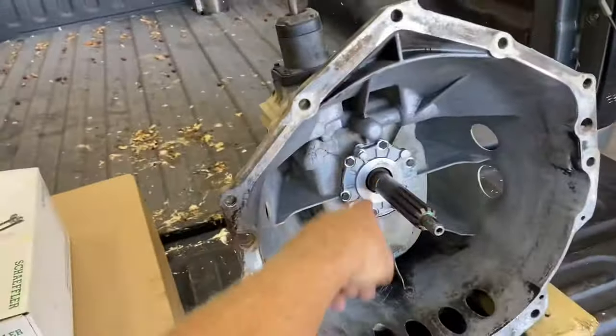I think we're gonna put that to the test, I promise. But I'm thinking that's gonna be about peak for them, 500-600. I'm thinking more of the 500 horsepower range. But anyway, this is their aftermarket clutch. There's the part number there, and I went with an OEM Summit flywheel for the 4.8, of course. But there's your part number there if you guys want to get it, 01 to 2012.